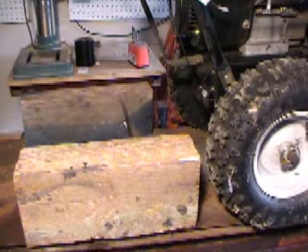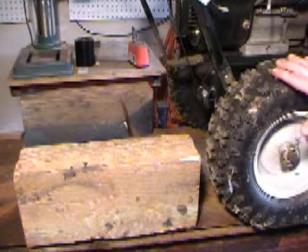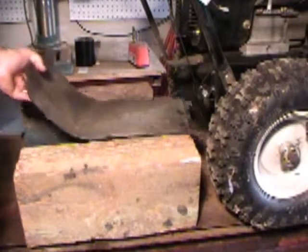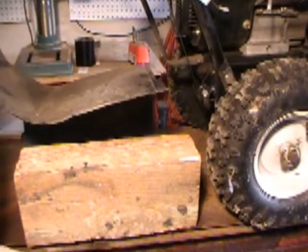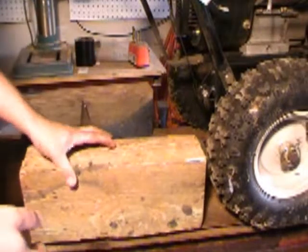The motor's all bolted down now. I gotta put the skid plate on — I find it easier since I have it up on the lift so I don't have to bend way down to the floor. You've got to get this slid way underneath; it hooks in and then you have six bolts that have to go in it. It's a little bit tight, there's not a lot of ground clearance, so what I'm going to do is lift it up onto some blocks.